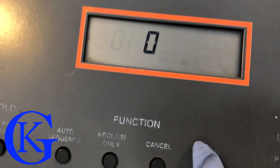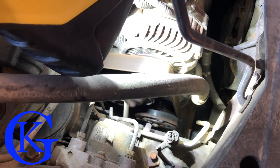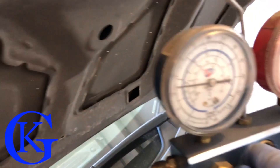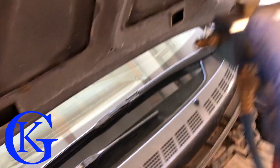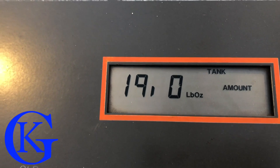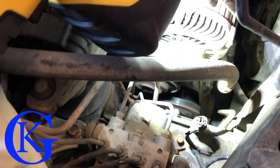I start on the low side, crack the valve, and the compressor should turn on once we get about an ounce in. I'm putting it in slowly and — there you go — it just turned on. I closed the valve, we're running on almost no pressure at all. Looking at the tank, it barely took half an ounce to trigger the compressor. It really doesn't take much.